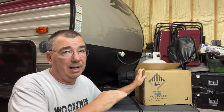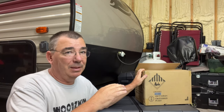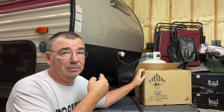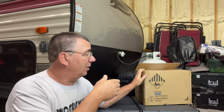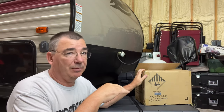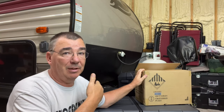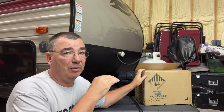This thing is a lot lighter. I want to do a weight test and see the difference between the lead-acid and the lithium-ion battery. This should be a big improvement as far as how long it will last. One cool thing about it is the chargers built into older travel trailers aren't actually designed for lithium-ion, but because this Uniwix battery has built-in protection, you can't overcharge it, and you're still safe to use it on this charger. You may not get 100% efficiency, so I may get a dedicated lithium-ion charger later.